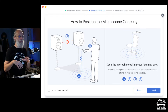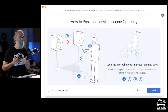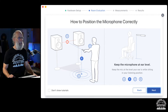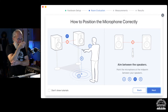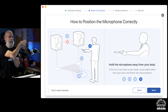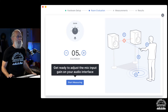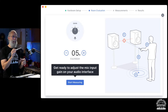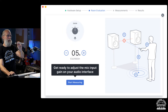It says to keep the microphone at the same level as your ears in the listening position — I'll be standing so my ear level is up high. Aim the mic between the speakers, and hold the mic away from your body so your head isn't in the picture. Then we adjust the mic input level and it runs a test to make sure everything's working. I've already adjusted my levels so when they're set just right it'll hit the sweet spot and start working.